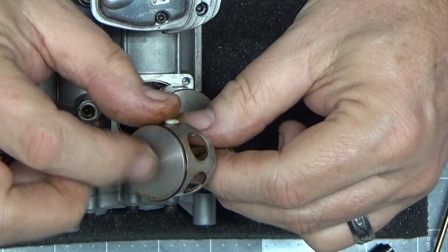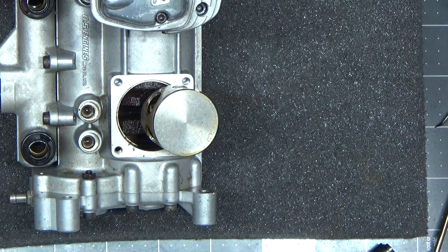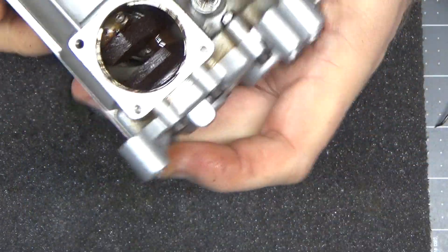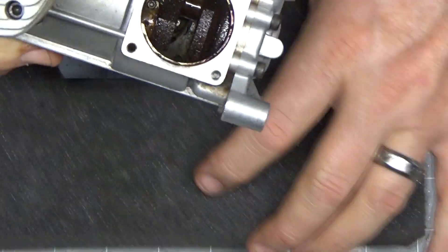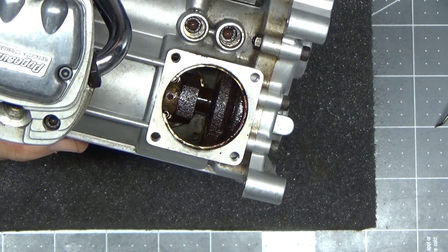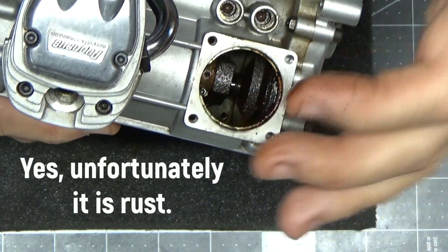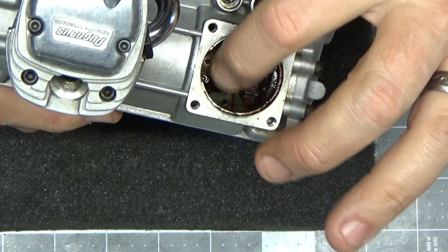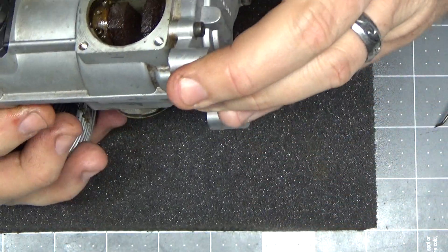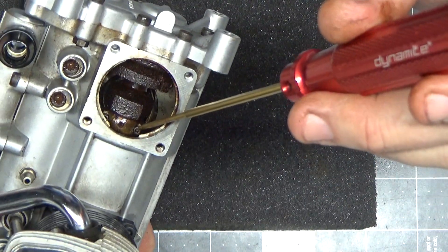There's just a lot of gunk on this piston pin and it's pretty much wedged on the connecting rod itself, so this whole thing is going to have to soak before I can actually pull that pin out. The good news is this engine looks like it's got incredibly low run time - the piston ring is completely free. The only unfortunate thing is the crankshaft looks really, really bad. I don't know if that's all just rust or a combination of rust, but it's going to have to get some serious, serious cleaning.